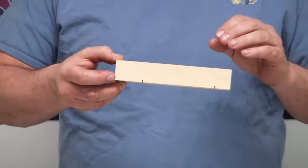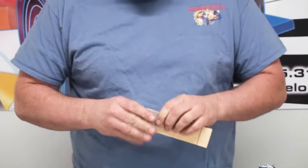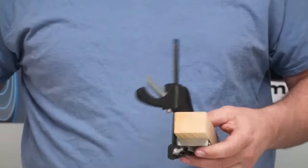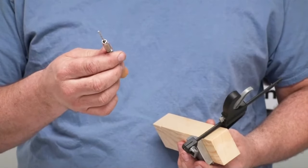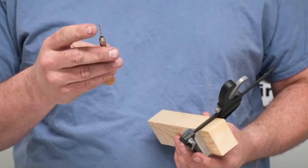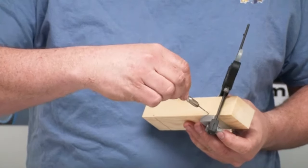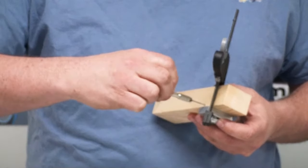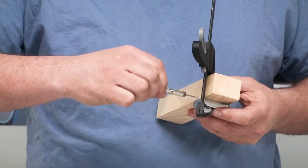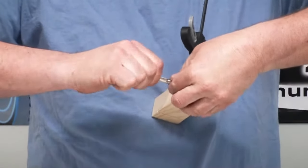If you don't have axle pliers, another way is to install the Pro Axle Guide back into the slot, clamp it down, and use a drill bit instead. This is what we call a pen vise with a number 44 drill bit — you can find it on the Maximum Velocity website. All we're going to do is insert this drill bit into the top of that slot and turn it back and forth, drilling a little hole without applying hardly any pressure whatsoever.